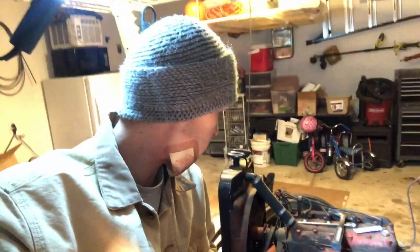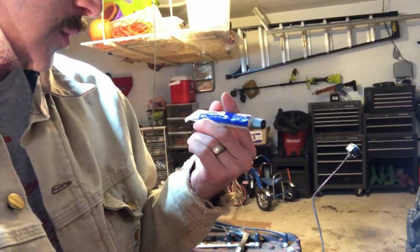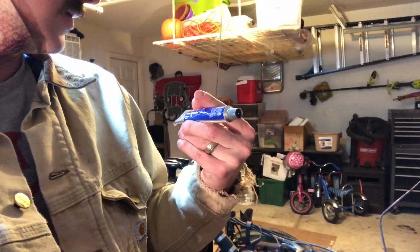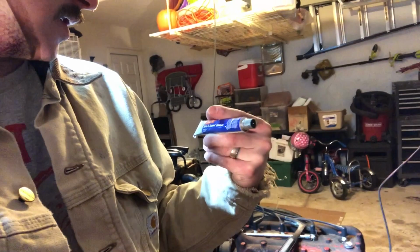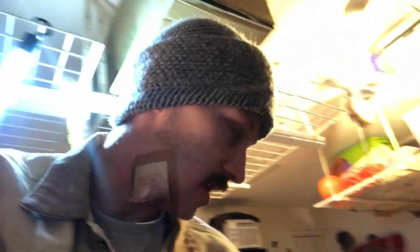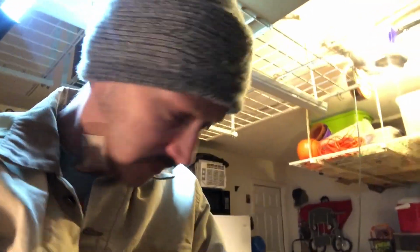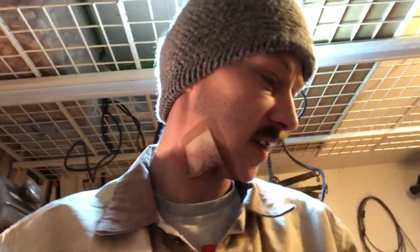And we're gonna get those freeze plugs inside of the block. They recommended to use some of this, what's it called? Permaseal or something like that? Permatex Formagasket sealant. One fast drying hard setting. So, I don't know. That's what they recommended using. A little bit on there to seal that when you do a freeze plug. So I'm gonna do that.